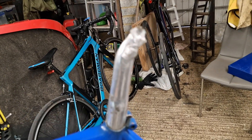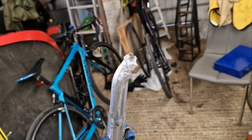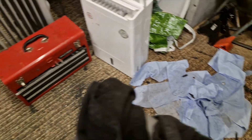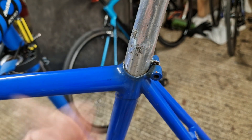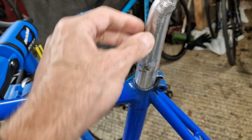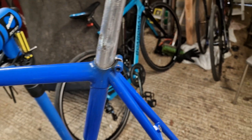I've dumped half a tin of Plus Gas down there - that didn't help. All it did was when I turned the frame the right way up, I tipped it all down my front. I've tried burning it - you can probably see it's a bit singed around here. I think because it's aluminium it hasn't worked - aluminium tends to expand more than steel, I think it expands twice as much or something. I've tried freezing it, although only with a CO2 canister, but all to no avail.